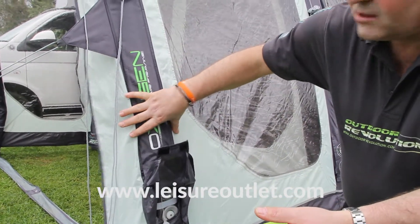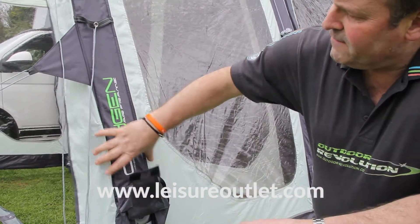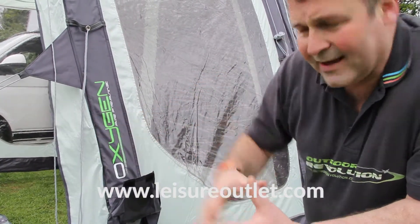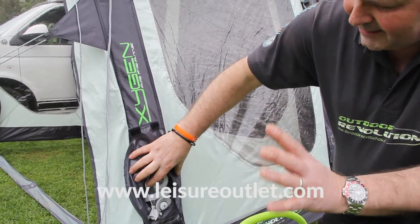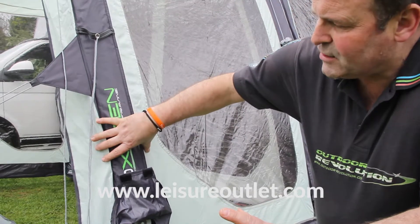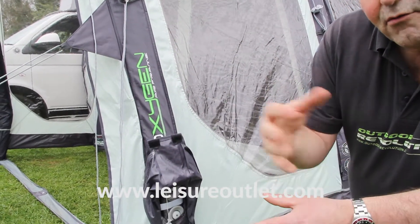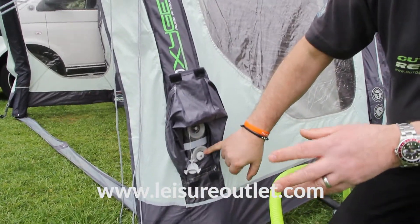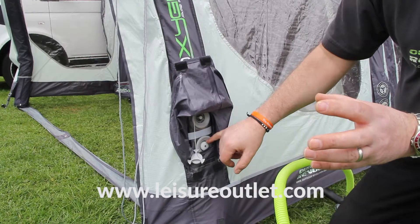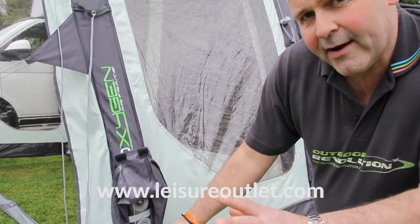You do not need too much air in the tube — you need room for expansion. However, if you put too much air inside the tube and the ambient temperature increases, if the pressure inside increases to more than 50% above our recommended psi, this exclusive pressure relief valve will kick in and release the surplus air. This will kick in at 50% more than we recommend.